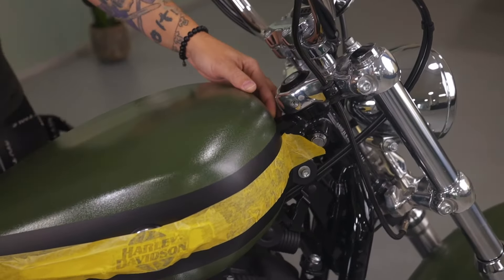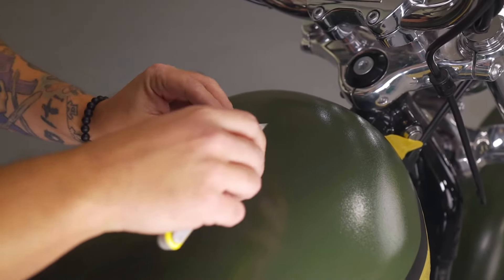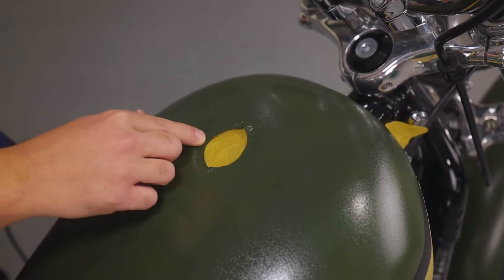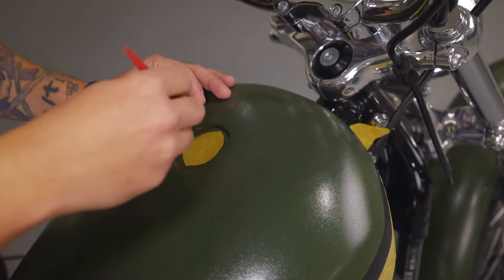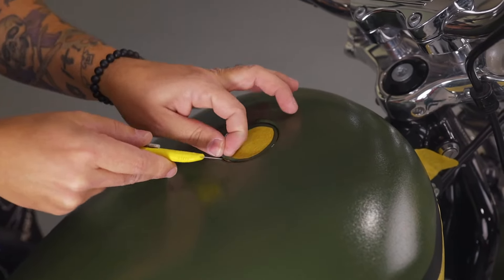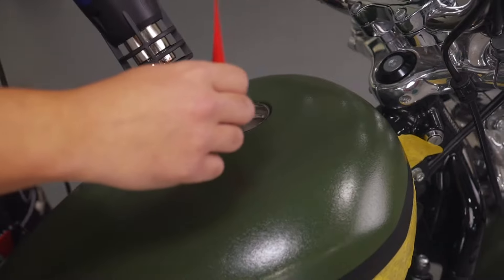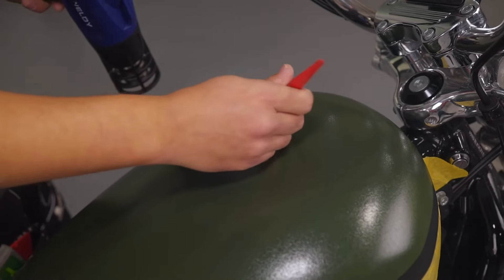With the main area complete, it's time to focus around the gas cap area. A good tip is to cut a quarter inch from the outside edge, add heat to shrink the film, then form it into place first with the finger on the top edge, then with a tucking tool from OurVinyl deep into the groove. Cut the excess film safely away at the bottom of the gas cap, remove the excess film, and come in with the tucking tool one more time to seal the deal, adding heat to double check. Once everything is sealed, put the gas cap back on.